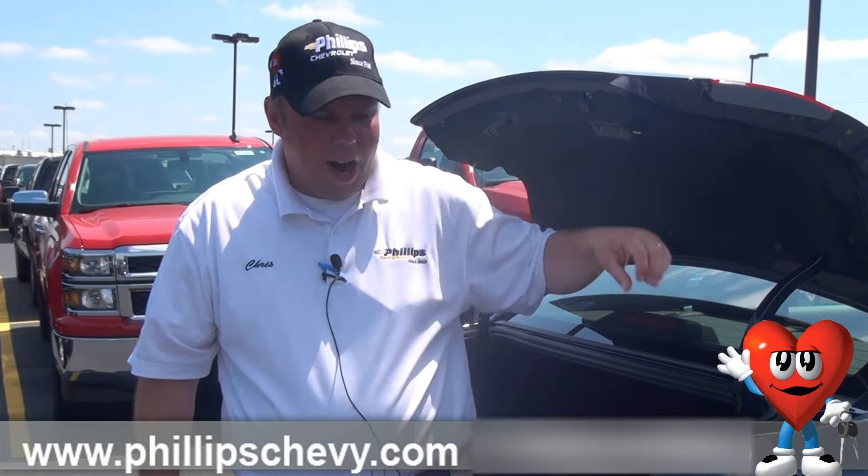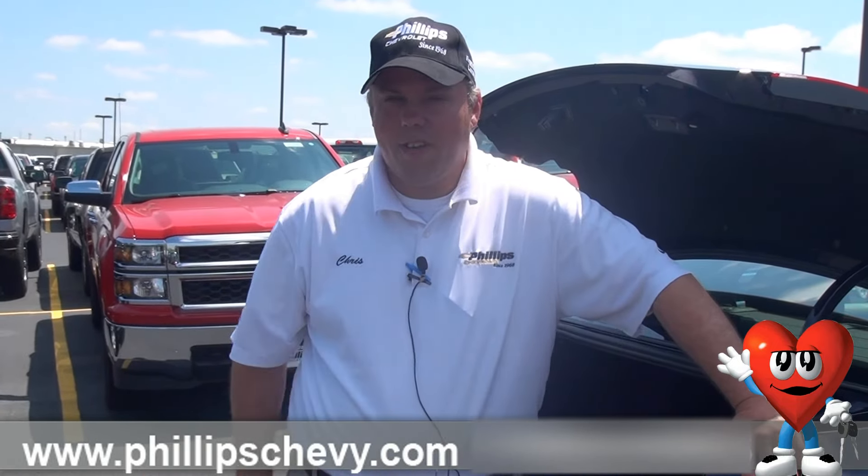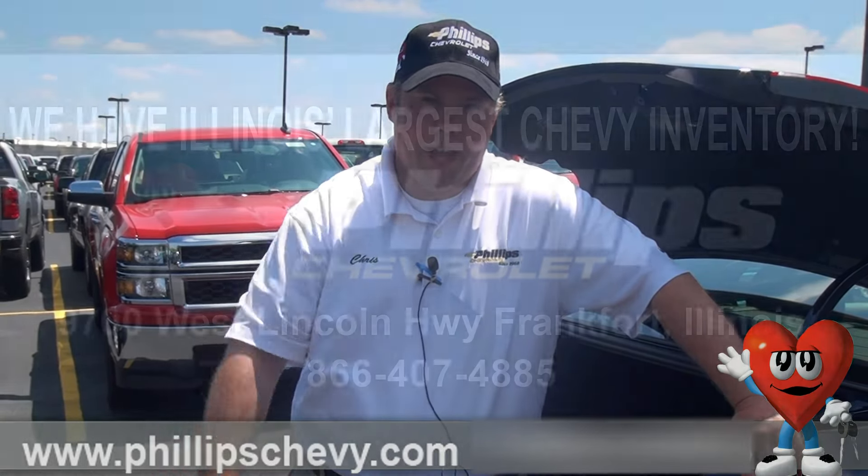Really easy — 1-800-CHEVY-USA, push the OnStar button, or pull out the tire and do it yourself. Be very careful, keep kids clear, keep individuals out of the car, parking brake on, car off, jack in a solid spot — you'll have no problems. If you want any more pointers on this or any of our vehicles, anything I can do to help you, just call Chris at Phillips Chevy in Frankfort and we're here to help you. You have a wonderful day.